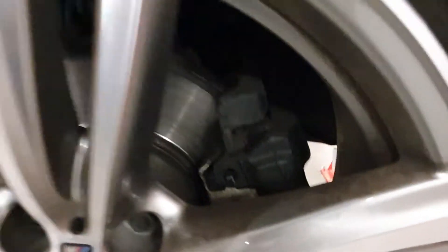As you can see, there are high spots on the edge and the lip, so the discs are worn, but they're quite badly corroded on the inside face. The pads are worn.